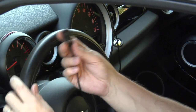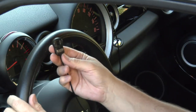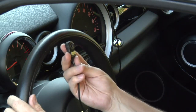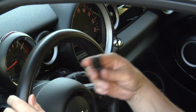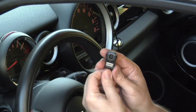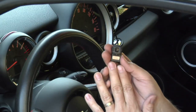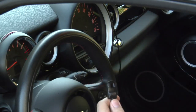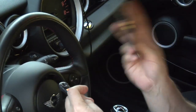There's another mode that's really handy — a valet mode. You can set the valet mode on your Sprint Booster to reduce the power output of your engine by either 55, 65, or 75%. If you're the kind of person who leaves their car with other people and you don't want to give them access to all the power, you can set that in almost exactly the same way as you set the pedal lock. Just make sure you read your owner's manual front to back so you'll be able to set it properly.